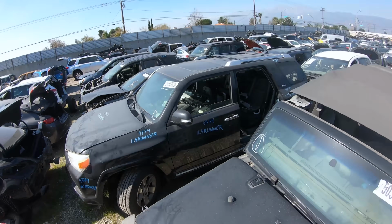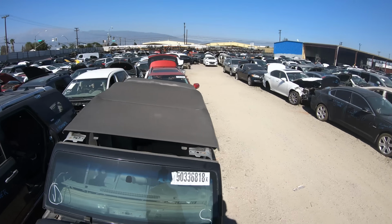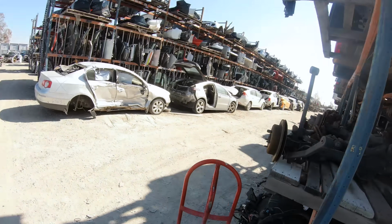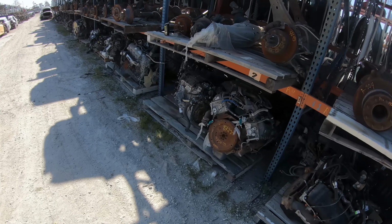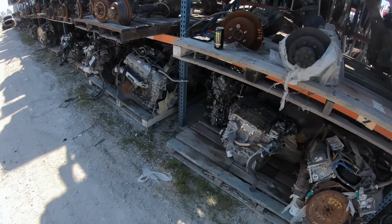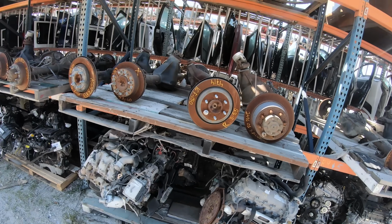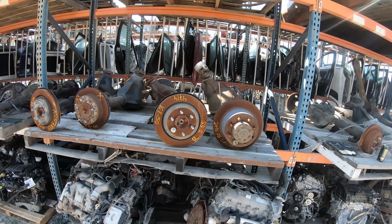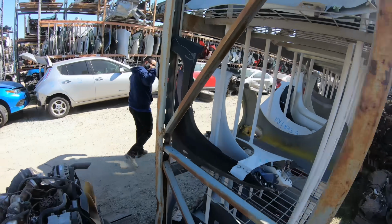I have to go out and find a motor, right? What size motor would you recommend in this thing? Being a two-door, it's going to be on 40s, 1 tons. I would suggest a 5.3. If it's a two-door platform, the 5.3 all aluminum base is a really good combination, and you can keep the cost down. It should be anywhere from $2,000 to $3,000, depending on who you get it from and how many miles are on it.